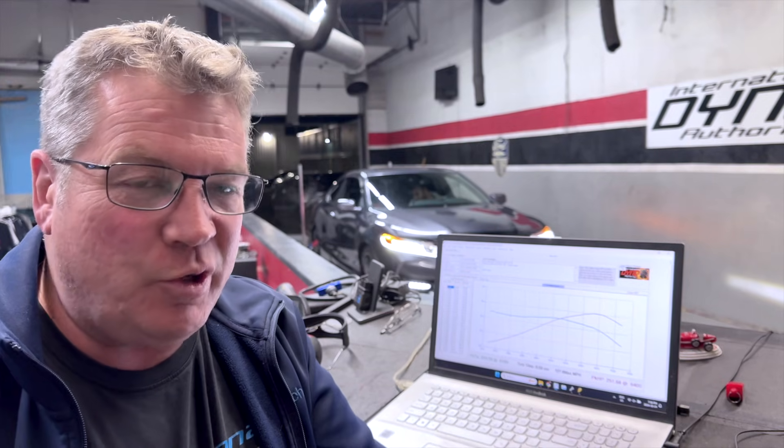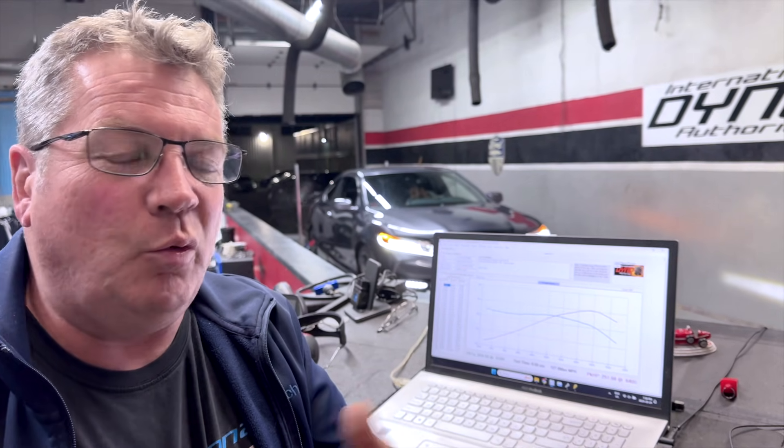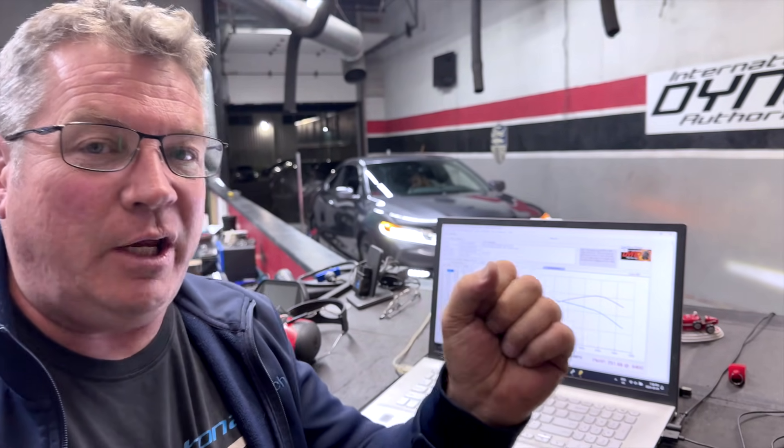All vehicles have safety setups. Sometimes you have a safety setup where if you change one thing, you'll have a knock sensor come in. The knock sensor will knock out timing to save the engine because you've made a change that the knock sensor table doesn't like, or your tune's too aggressive and you're causing knock. In this case it's completely different — they actually have a cat over-temperature table. The catalytic converter, which takes pollutants and turns them into water and oxygen, has a table in there so that if we lean out the fuel a little bit to make it normal, that table will actually overwrite it and go right back rich anyway. And that's what we were seeing.